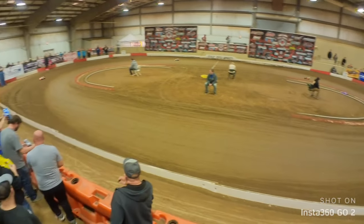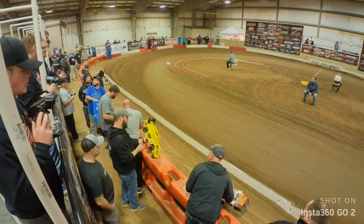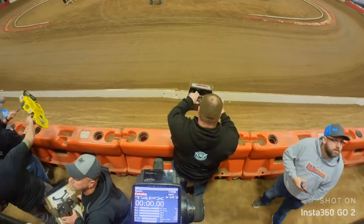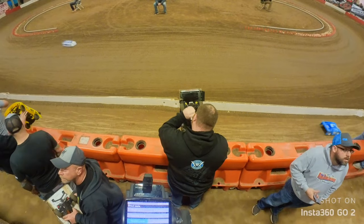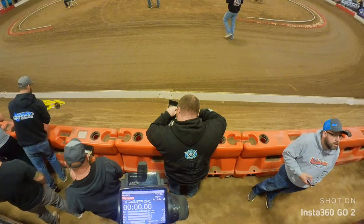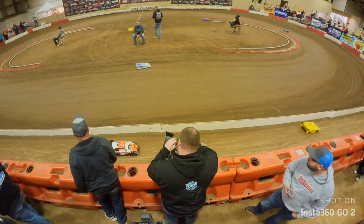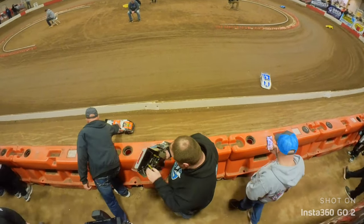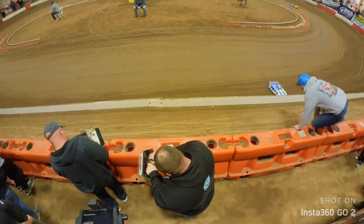It's a little aggressive coming in. All right, at first we got this late model. Late model feels a little loose coming in. Kevin's gonna bring the right rear forward lightly and then give it some drive off. So, not very much. I did mess with my radio. I've been tweaking with the radio, trying to get the speed setting. The throttle speed, I turned it back down so we won't blow out the tire. So, little small adjustments and see how it goes.